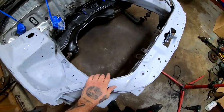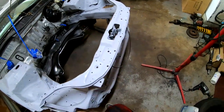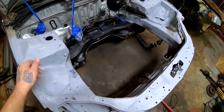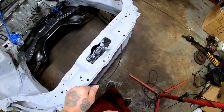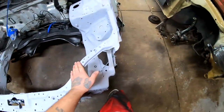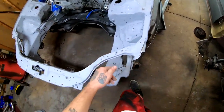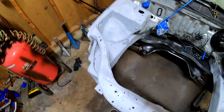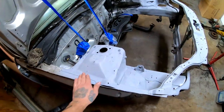I'm gonna go ahead and lay a little bit more primer. I'm gonna wipe everything down with the mineral spirits and then lay some more primer down. But it is pretty smooth. I think that I did burn through it because I only had about 2 coats of primer on. It really wasn't that thick either. It was just like some quick coats that I gave it.